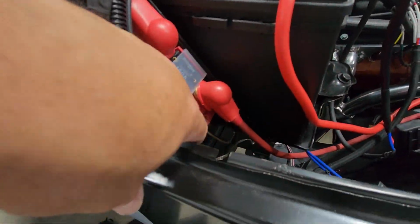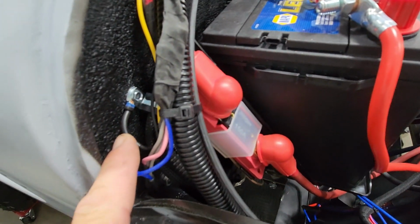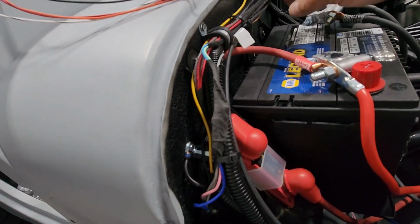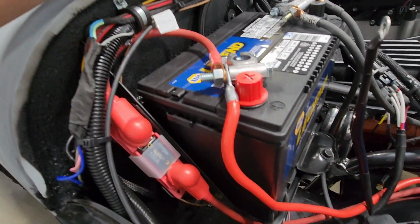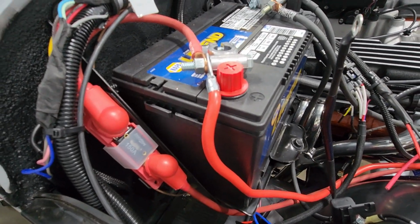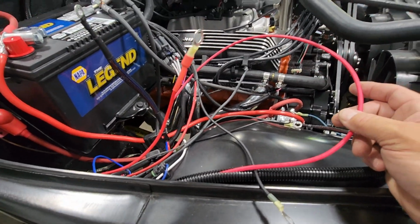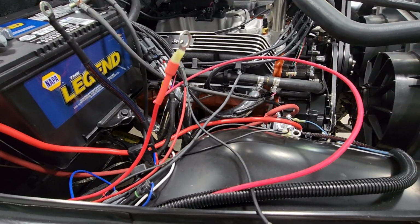We have our blower motor hooked up. Now there are 2 wires with the harness. There is a ground wire, which I hooked up over here to the firewall, which is technically not even needed. It's given in the harness in case you have a fiberglass tub. The blower motor basically should ground directly to the firewall that it's secured to, and it's just one single power wire. So, okay, as soon as I get those bus bars and I'm able to get this organized and secured, I'll come back and get that on film, and then we'll be wrapping up part 3 here.